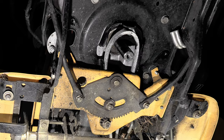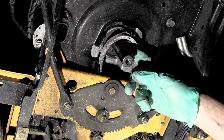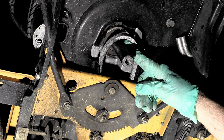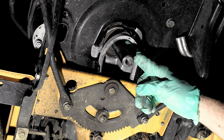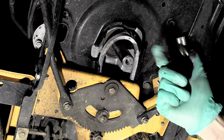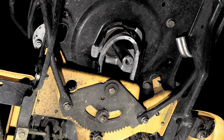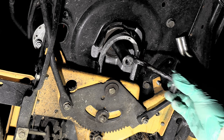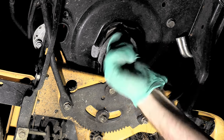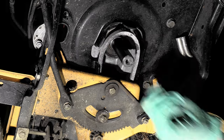And then up around to the engine crankshaft. One thing I wanted to mention before we put the pulley back: if your pulley is rusted on there real bad you're going to have a really hard time getting that off. You don't want to try to bend up the V pulley. The solution would be to bend these belt guards back so that you can get the belt on and off, then bend them back when you're done. If yours isn't rusted, you might want to put a little bit of anti-seize on the crankshaft — just smear it all over with a really light coat so that it will come off easily in the future.